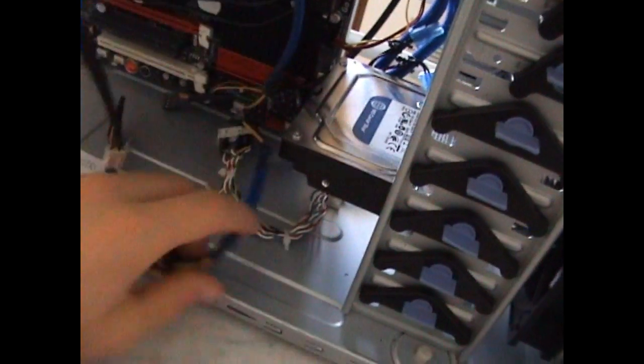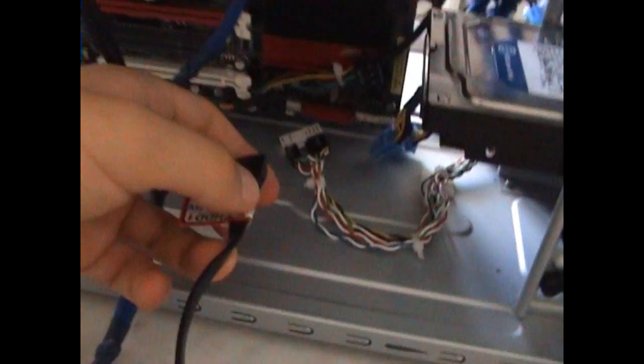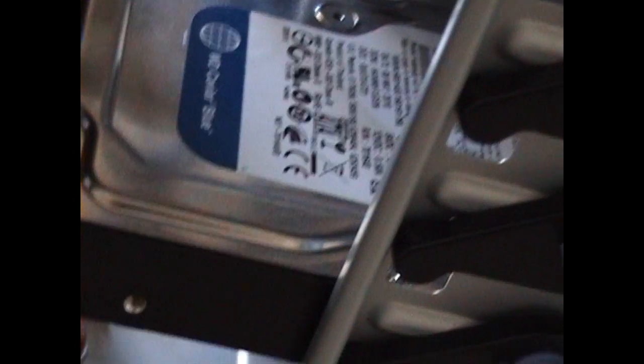Now the hard drive is locked, so let's connect it to the motherboard. You will need a SATA cable. This motherboard has two dedicated red ports for hard drives, so it's very easy — just take a SATA cable, put it inside the port, then connect it to the SATA connector on the hard disk drive, and you're done. The hard drive is now connected.